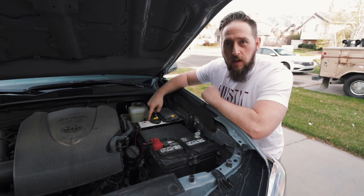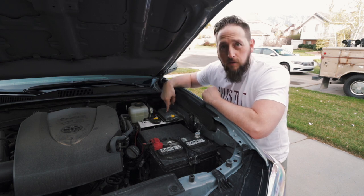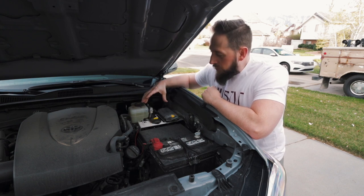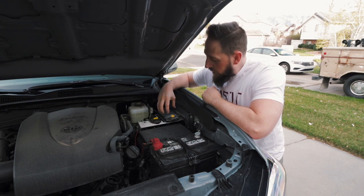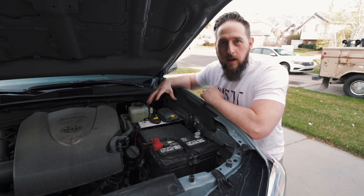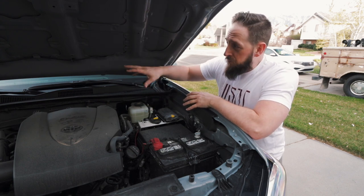As you can see, I have the Overland equipped tray with the 100 amp circuit breaker and my 12 block fuse block. We're going to be removing this and installing a new tray that incorporates the Switch Pro SP9100. If you decide to go this route without the Switch Pro controller, you're going to have to figure out a way of running all the relays that come with the wiring harnesses for your accessories.